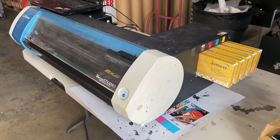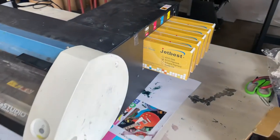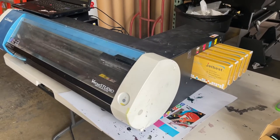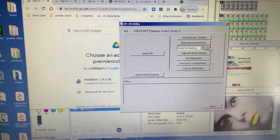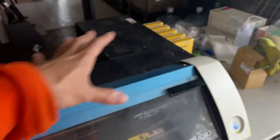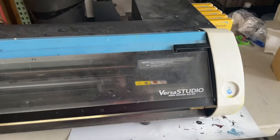So he wanted us to go ahead and flush the printer. We use JetBest cleaning solution, made in Taiwan. What we do is insert all the cleaning cartridges, go to Roland BN20 utilities, and press five times powerful cleans. That will flush the lines and the solution will push all the ink through the lines into the waste cartridge, and the lines will be cleared up very well.